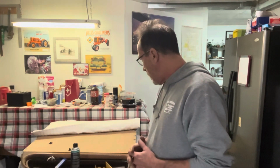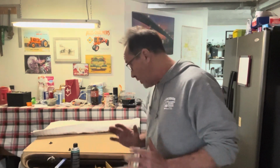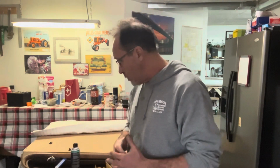We learned a lot doing this door panel. Mistakes were made. Never done it before. In the end, it turned out pretty good. We had some wrinkles in it. We took a wet towel and ironed it out from the back side last night, and we laid that wet towel on the front side and ran an iron over it. We got most of the creases out of it. We should have done that first, where the vinyl was folded. We should have ironed those folds out.